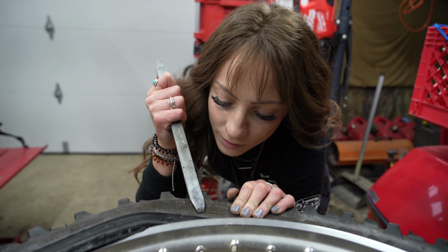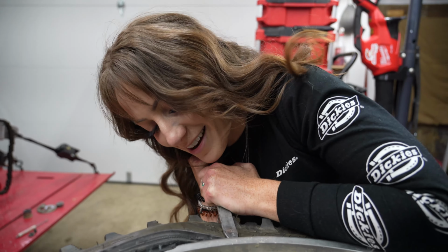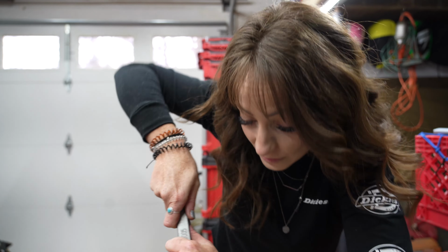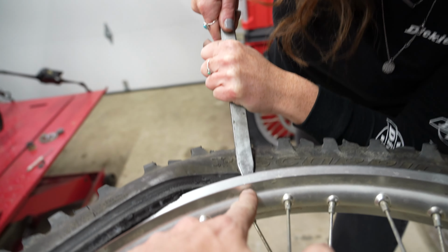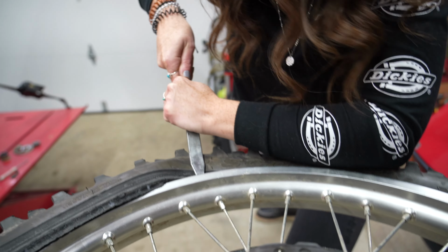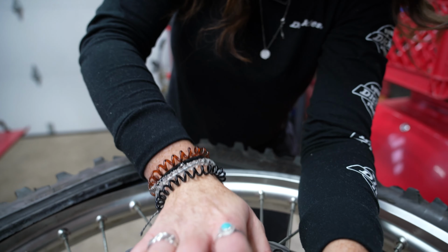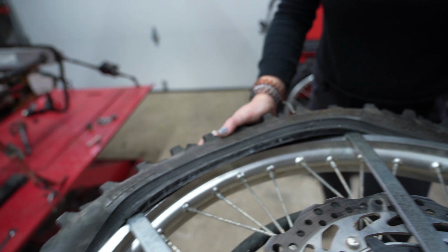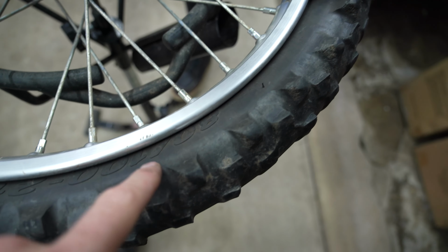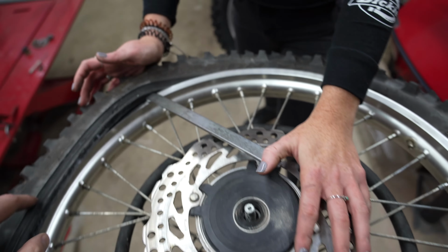This is the only part I have trouble with. What part? You have never done this. You don't know that other parts are gonna be struggling? No, I just mean, I feel like once you told me to hold onto this, I was able to lift it over. Right. Getting it in. Well, you're too far. So go right there, and then push down and push in. And it'll be smooth sailing for now. Now you got the majority over there. Look how little of the sidewall is showing. This is pushed all the way down on the drop center, so you're gonna be super loose now.